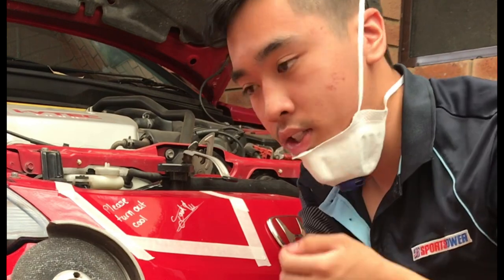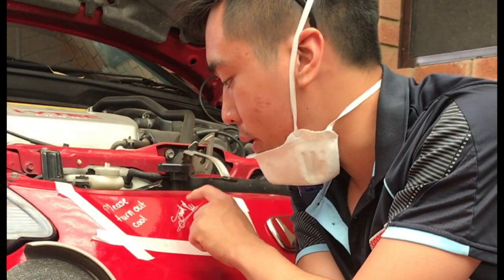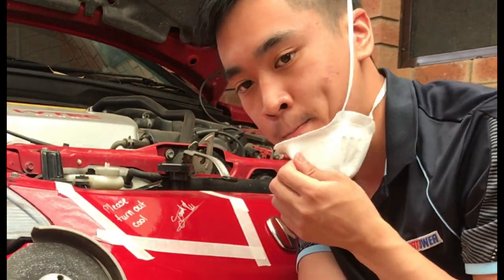Alright, so let's start with cutting. Make sure you put on your mask and your safety glasses, because we're cutting fiberglass and you don't want to be getting any of this dust in your lungs.